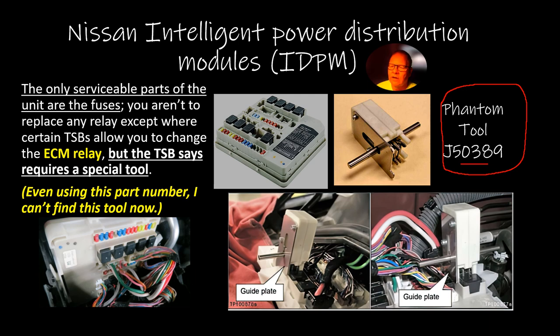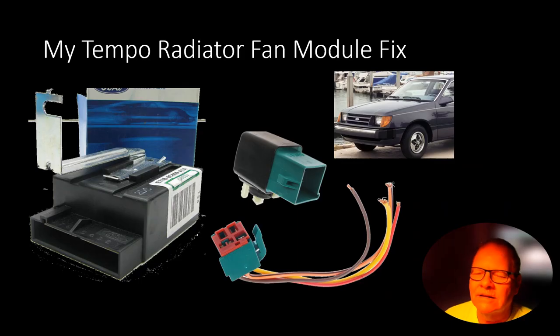We had to work on these — this is a photo I took of one we worked on at the college, and that's another view I found online taken under the hood of a vehicle. Some Toyotas have relays that are all made together; you can get to them, see them work — no covers on the individual relays, just a big cover over the whole thing. Ford actually did something similar beginning in the mid-'80s with a cooling fan controller module hooked into the AC. When you turned on the AC, it knew to run the coolant fan. It had a relay built onto its circuit board that tended to fail and burn out because that coolant fan carries a lot of juice.